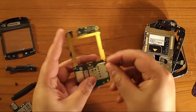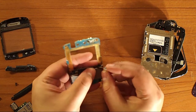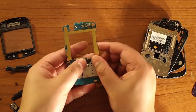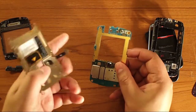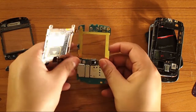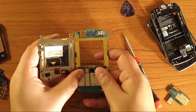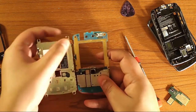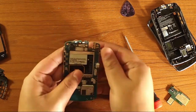Now the trackpad — we put it back on. Make sure that it's upside down like this when you plug it in because it's going to fold over. Pull it back over. Then we plug in the keypad — flex cable here, just line it up nicely and push it in. The trackpad is in, we plug in the keypad. Make sure the LCD connector goes around the back of the motherboard, flip it around, and plug the connector in gently. Make sure it lines up nicely.